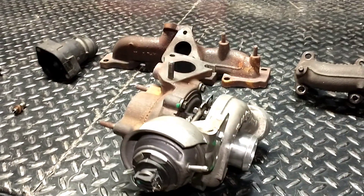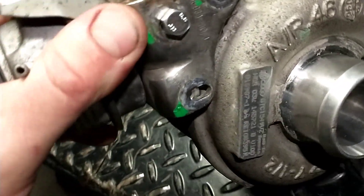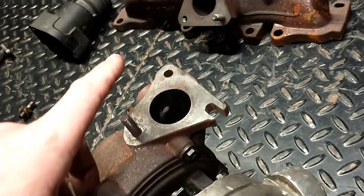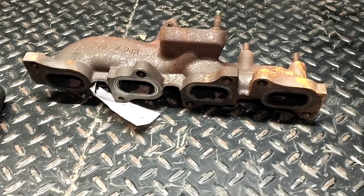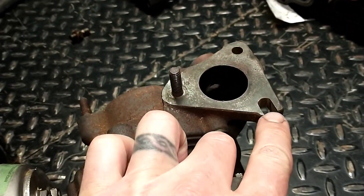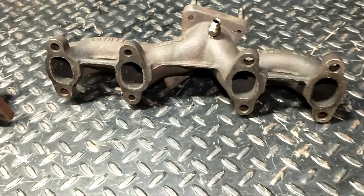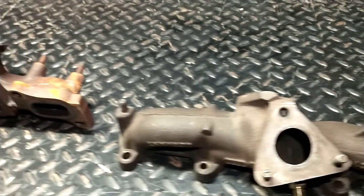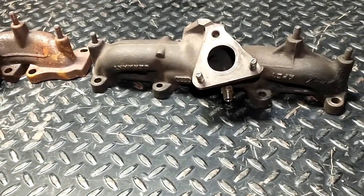It's a pretty sweet upgrade off of a 2014 TDI. There are a couple of different variations — the US spec of this turbo, the GTC1549 VNT, comes with the manifold pre-attached. It's for the newer 2.0 common rail TDI. Overseas it came with a flange. The European model is the one to start with to bolt to that 97 through 06 TDI — it also comes with a three-bolt flange, but they're just a little bit different, so this needs to be notched out. A BHW manifold would be about the same.